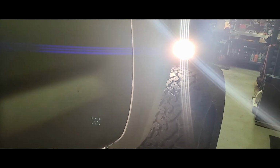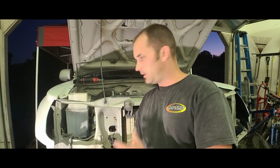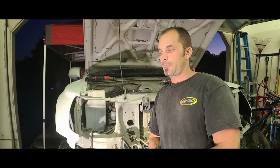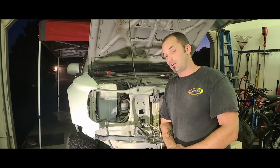And like, I'm impatient and I just want them on, and especially it's late. I got a lot of stuff to do tomorrow personally. But sand a little bit, put it back on, get your fitment, sand a little bit, you know, however many times it takes, because it's really gonna matter down the road. And especially if you're jumping your truck, it's gonna get some damage. Or if you're rock crawling, there's a lot of vibration, there's a lot of impact that's happening. And so you just want that fitment correct, so it just forms to the hard sides of what you already have there. That's all I can think of right now.